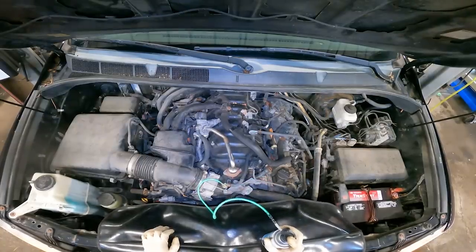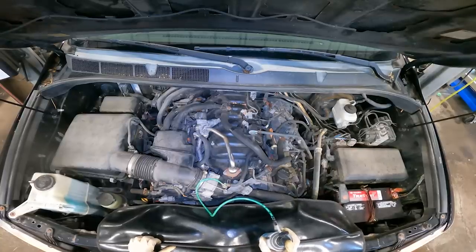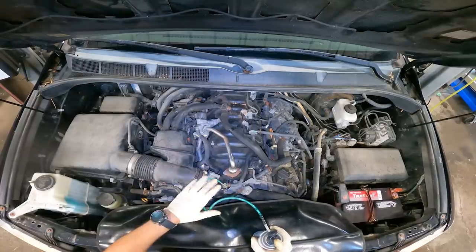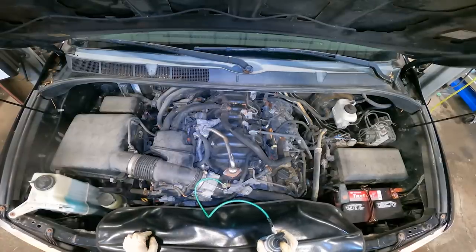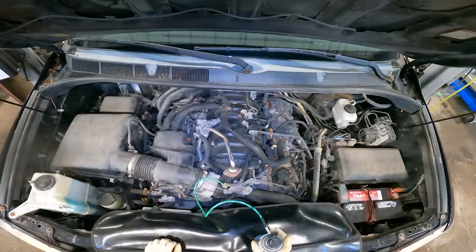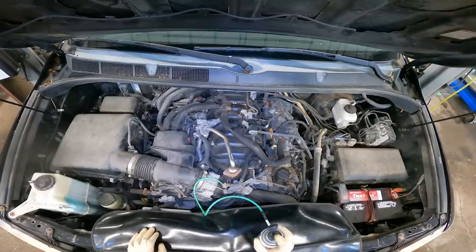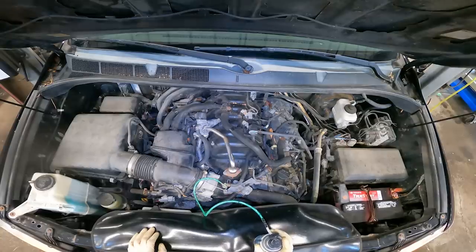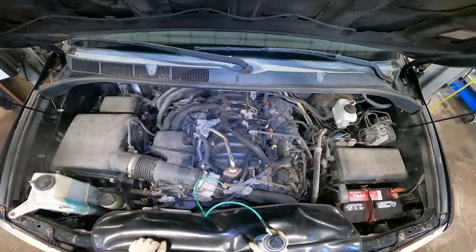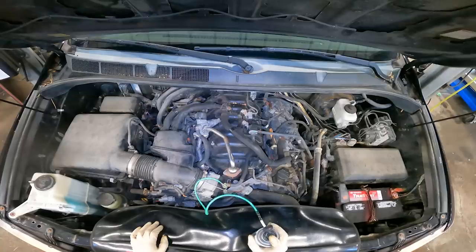We're running — a little spray here, a little spray there. You may hear the idle dip a little when you put too much in — but you never want to get lost in the sauce. You can see the idle dip down a little as the car gets warmer. I think the road test is going to go very well. The customer is going to notice improved throttle response, and the car won't have a slow crank anymore with the new battery. This service isn't really recommended on new vehicles since carbon takes time to build up, but the customer will 100% notice a difference in throttle response and may even see a change in gas mileage.